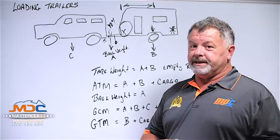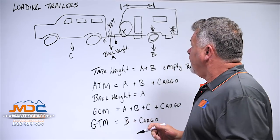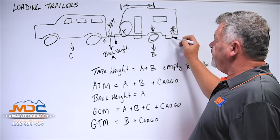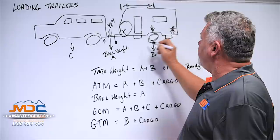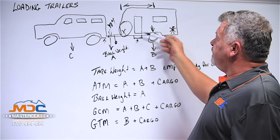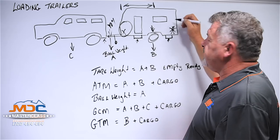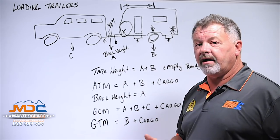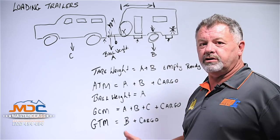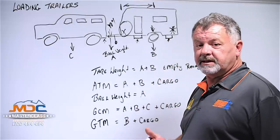Now talking about water tanks — often caravans will have water tanks fore and aft of the axles. If you're having a bit of trouble juggling the weight, you can actually manipulate the weight by filling or not quite filling the front and rear water tanks. If you're a bit light on ball weight and you want a bit more weight at the front, fill the front one and put less in the back one, and vice versa. But remember, the more weight you add at the back, the more you can increase the pendulum effect. Generally, caravans will be well designed — MDC caravans are designed so you don't have too much capacity at the back. They're a very well balanced item, so it's something you can keep in mind to assist in getting the handling right.